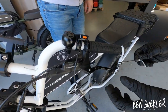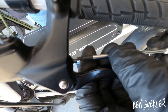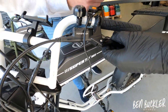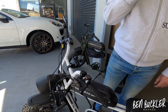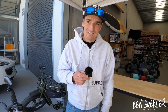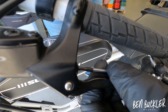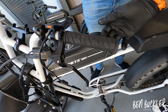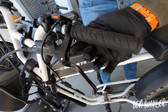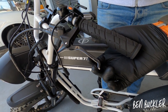We'll get a small Allen key and stick it in there. The first one was a bit big — choosing the right tool is important. It's actually a 2mm Allen key. Stick it in there and just wind that back. Now it's flush with the handle and it should stop the brake going all the way back to the handlebar.